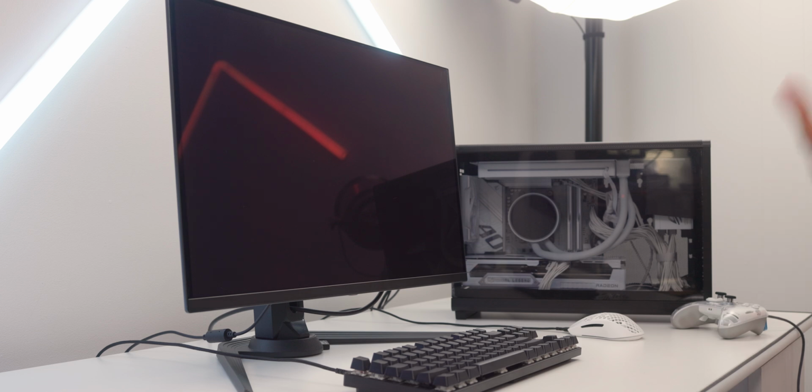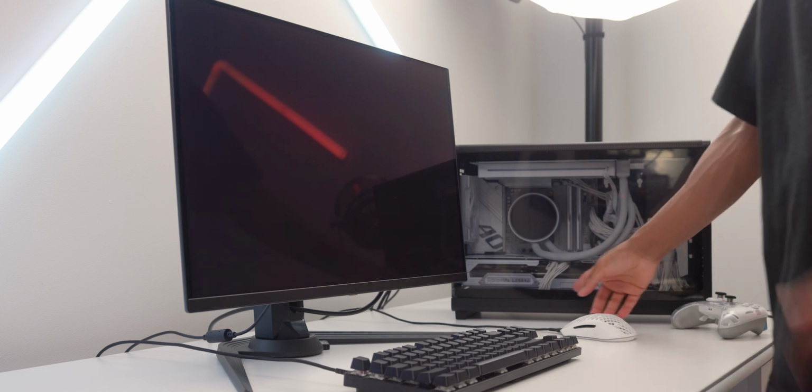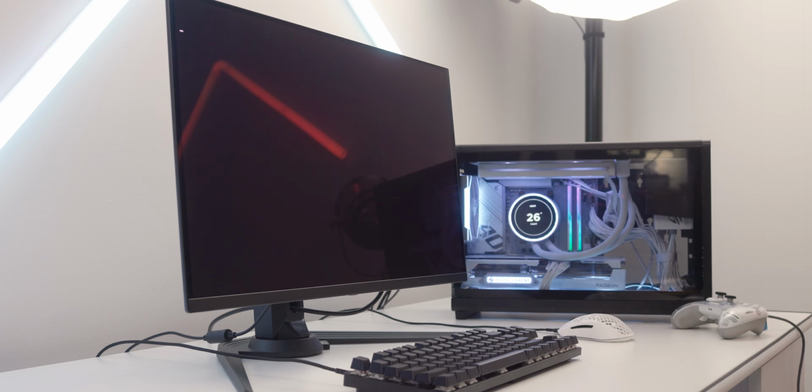It has its things that you always have to work out every now and then, especially with these smaller form factor builds. But that fan issue was something that you wouldn't know until you boot up if your motherboard didn't have enough power to power the fan. So now we have them running to the SATA power. So let's boot up. She look good. YouTube, we got power, baby. We have power. We have lights, we have cameras, and we have action.